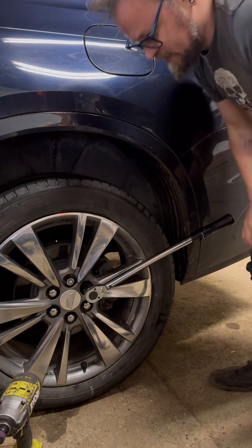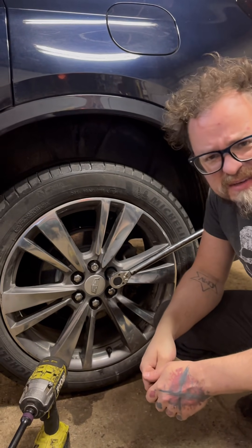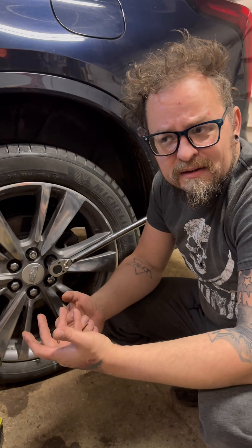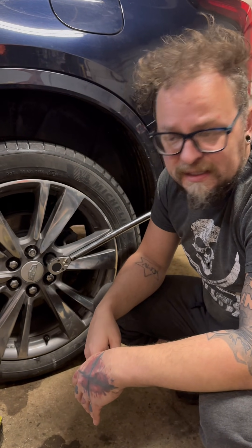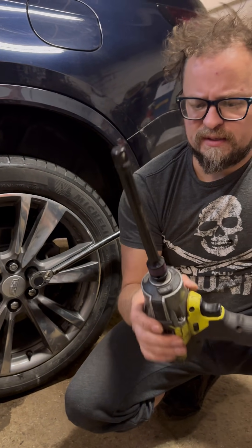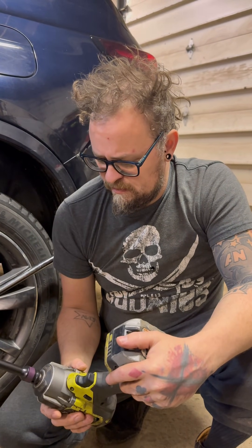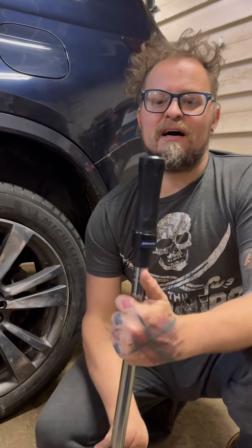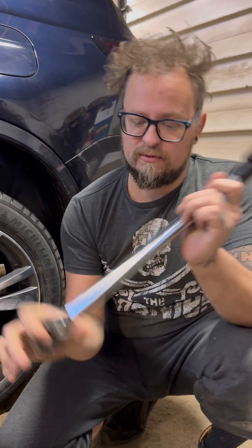It moves at 160, and at 150 it just barely moved a little bit, so it's about at 155 — and it's a 130 torque stick that I don't use. When we tested three different torque spec sticks, they were all dead on when they were new. I don't know if we tested the 130 or not, but this torque wrench did take a pretty big hit — we've got a crack in the handle and the back cover popped off. It could be the torque wrench that's off.